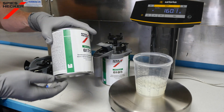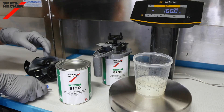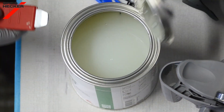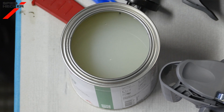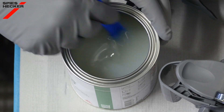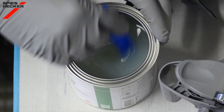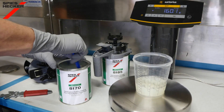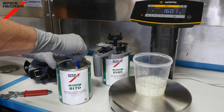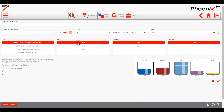When preparing the clear coat ready for use, it is simply a repeat of the correct combination of the two clears that you identified when you made your spray-out cards. Stir the material thoroughly before each and every use — note that we have deliberately under-filled the can to leave room for stirring so you do not lose material over the top or sides. The colour software will guide you through the required mixing steps, which helps with accuracy and reduces mistakes. There are guides for the different matte levels in the TDS but using the colour software and weighing across the scale is strongly advised.